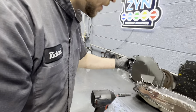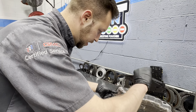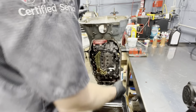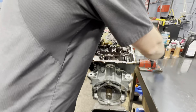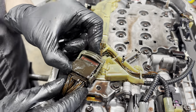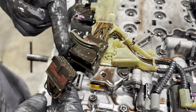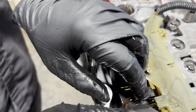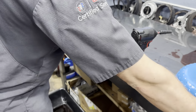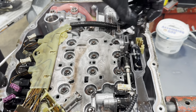Here's our filter — I'm sure this is pretty nasty. We can look at that later, but we're not going to see much, just clutch material and stuff in there. And this really is a good sign — they probably replaced this because see how this is a two-piece harness? The early GM 8-speeds when they first came out were just one piece, and they failed a lot. To replace them you'd have to remove the valve body just for the harness. So it seems like this was replaced at some point, which is actually good.